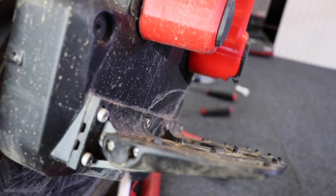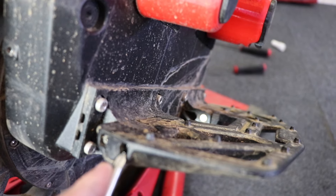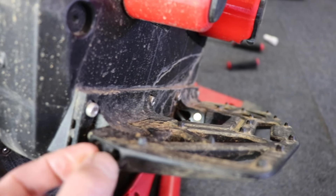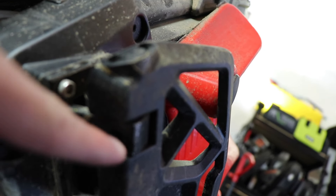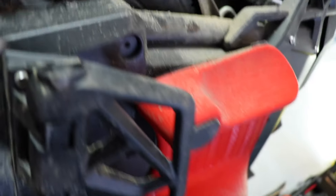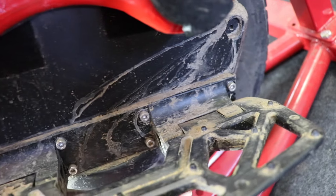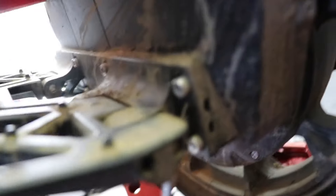So when you're putting on this lowering kit, you want to take out these pedal rods. It's a little different on this wheel than others. Undo these two screws and this cover pops out. Under here, undo this screw — this is what's putting tension on that rod. Just loosen it and it should let you pull the rod out. You can tap the rod out this way. Same with the other side — these rods used to go all the way across these pedals.